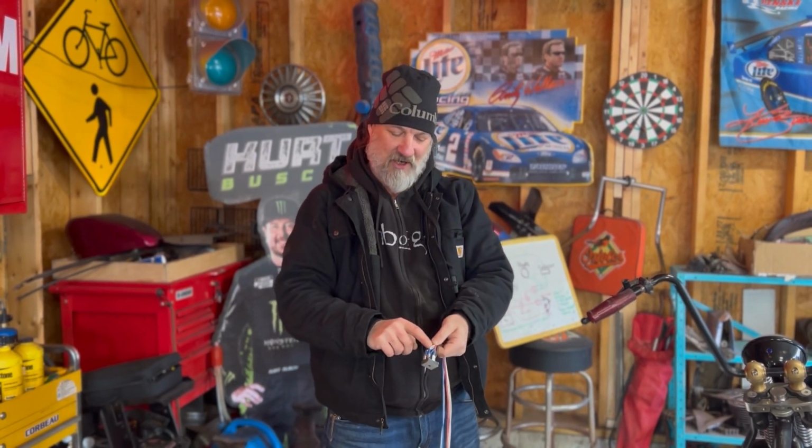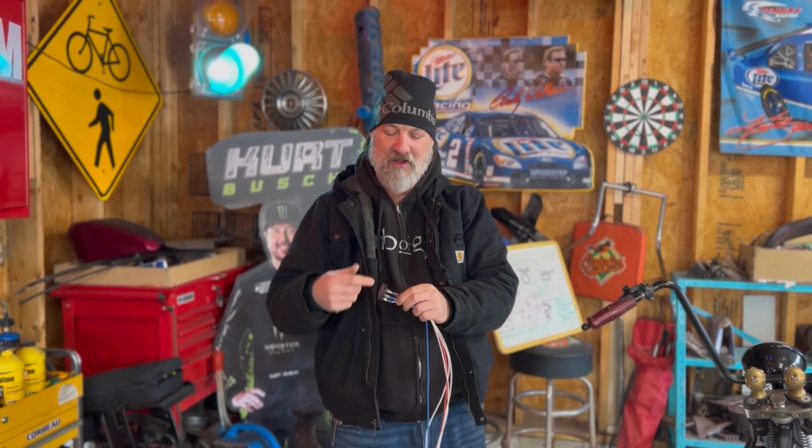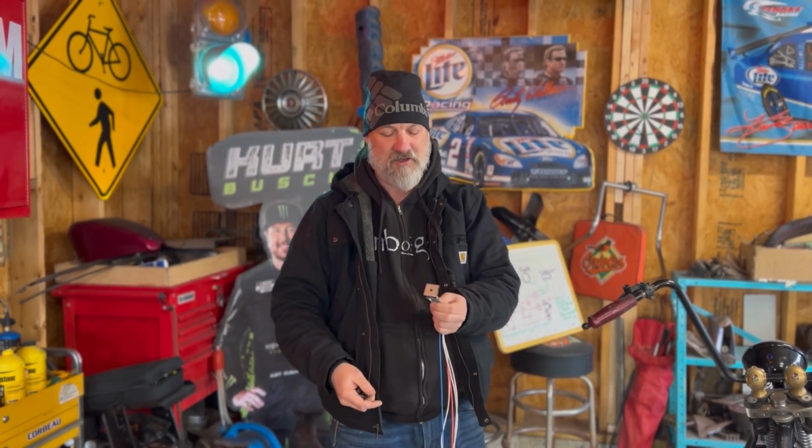So it's got the 3 coming in from each copper coil in the stator. And this thing only traps the positive and allows the positive to go out. So then it's got a positive out and then a negative connection. It traps the negative, doesn't allow the negative current to come out, and only allows the positive to come out. And for those of you who didn't understand what Steve just said, go to TC Brothers and get the 3-in-1 kit. I might not be explaining it totally correctly.